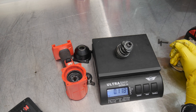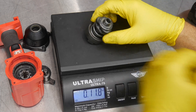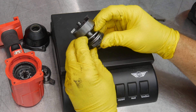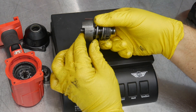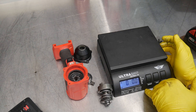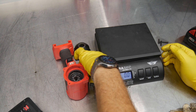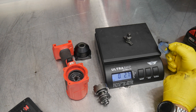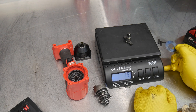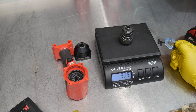So you're at three quarters of a pound — about 12 ounces. That's definitely a decent-sized impacting mechanism. You've got a nice thick steel here and a pretty heavy-duty spring. I'm just surprised it doesn't hit harder than it does, because it hits almost like an impact driver rather than an impact wrench. There's a big difference when this hits compared to a Milwaukee or Makita or any other mid-torque or compact impact wrench. Let's weigh the anvil — 2.7 ounces. That's not bad at all. Switching to grams: 75 grams for the anvil, and the impact mechanism is 335 grams.